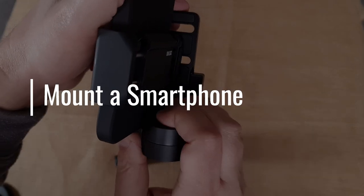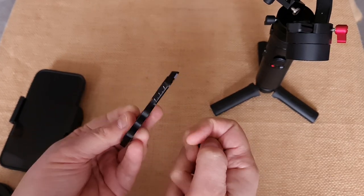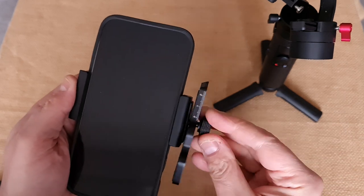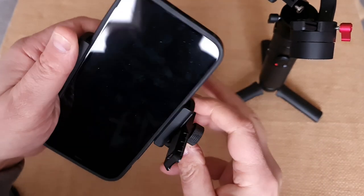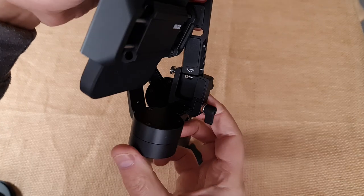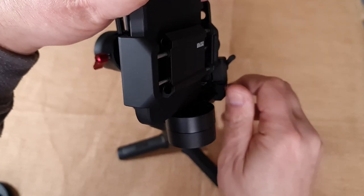Here's how to mount your smartphone. Place your smartphone in the clamp. Bolt the clamp to the mounting plate — there are two slots; the shorter one is for smartphones, and there are two holes in the clamp. Choose the one furthest from the back of the clamp, as this pushes the phone forwards and helps the balance. The position of the bolt in the plate needs to be adjusted later. Make sure the lock screw is loose — the button is a quick release for the plate. Place the mounting plate into the gimbal arm, make sure the plate slides all the way across, then lock the plate in place by tightening the screw lock.